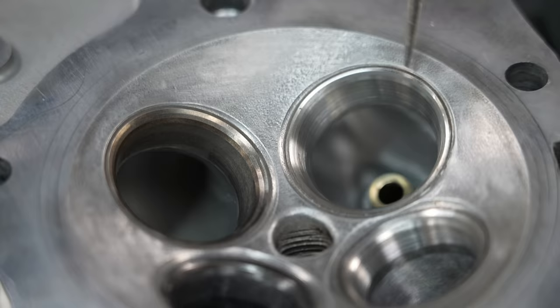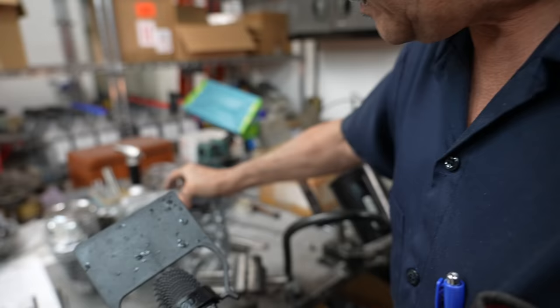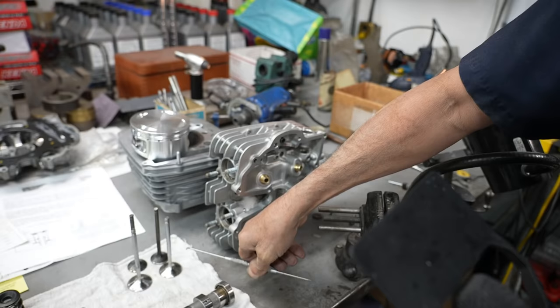So this hole is much larger this way as opposed to this one, because I'm putting in a 1mm oversized valve in it. I'm going to show you guys how to put the guides in and re-grind the other two seats in a few minutes.